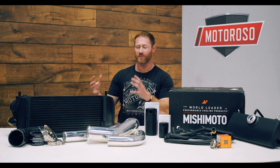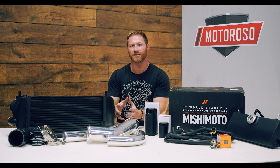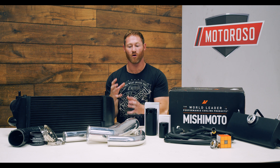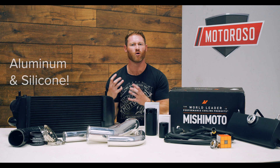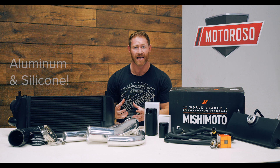When it comes to generating colder intake temps on a turbocharged engine, the key is an upgraded intercooler. The Mishimoto intercooler for the 3.5-liter EcoBoost comes in a variety of formats — you can buy just the intercooler or the full intercooler kit, which includes all the cold side and hot side piping. We recommend the full kit because the stock piping is plastic and rubber. All the Mishimoto piping is aluminum — stiffer, holds up to temperatures, and handles higher boost PSI.